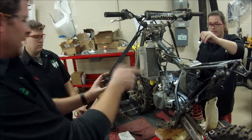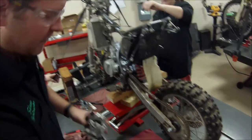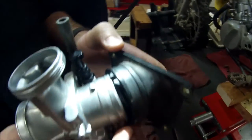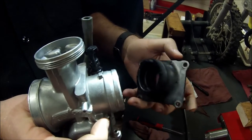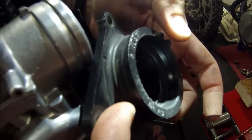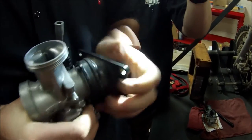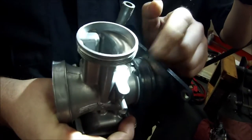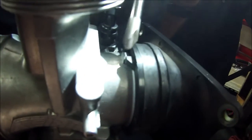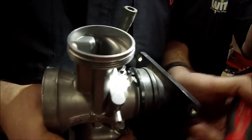Leah here is putting together this RM 65 and we're getting ready to fire it up. I took another carburetor just to show an example. First off, can you guys see this machine groove in here? The manifold has a rubber lip sticking out — that's supposed to land in that groove. On this bigger carburetor, it also has locating tabs. When we install these on the bike, we want to make sure the two halves are together — the cast aluminum tab on the carburetor sits between the rubber tabs or ears on the manifold — and that it's fully seated.